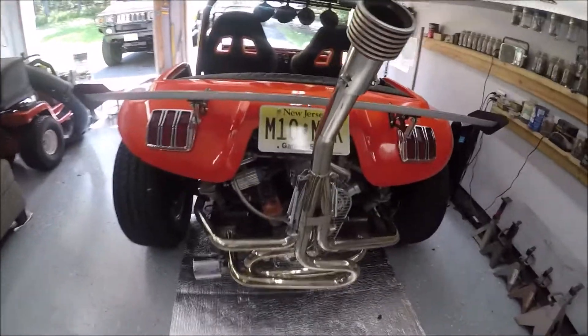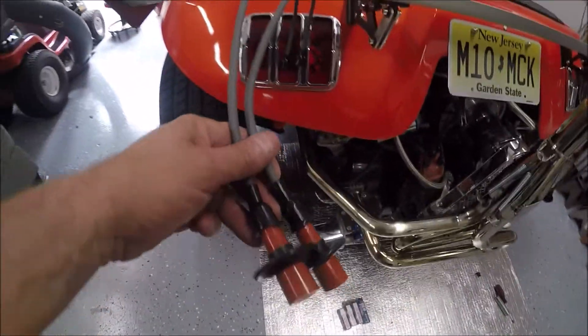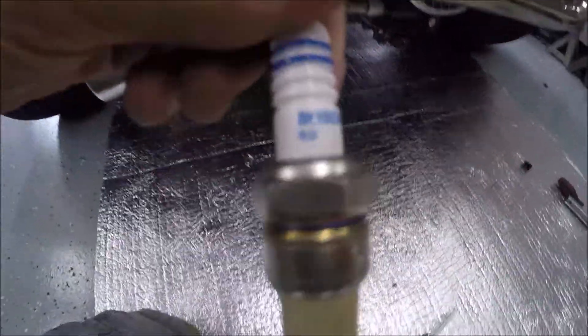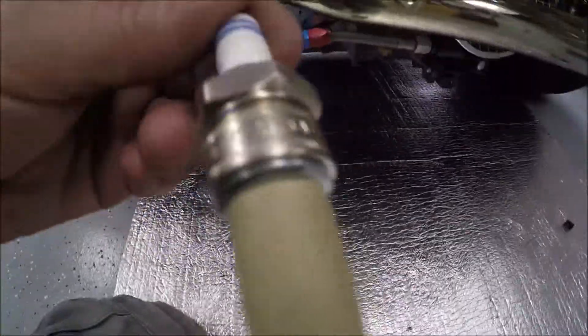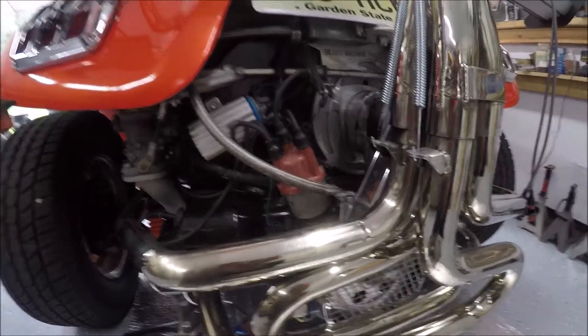Timing is already correct. I already got the plugs, so let it cool down for a minute, change out the plugs and wires, and see where we're at. We're going to be using these middle-of-the-road MP plugs that got pretty good reviews, and we went with the original Bosch spark plugs — they just say R0 but this is what was recommended. I already pre-gapped all these — gap was 0.024, so 0.025, close enough. Let's get this changed out and see if anything changes.